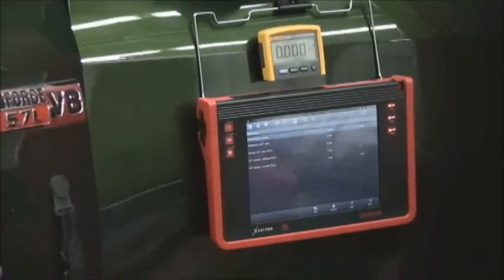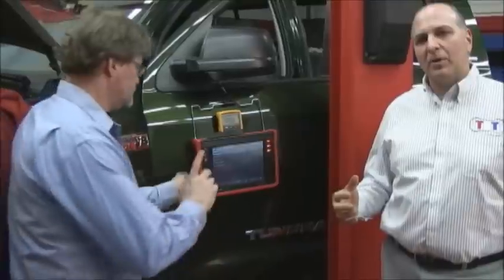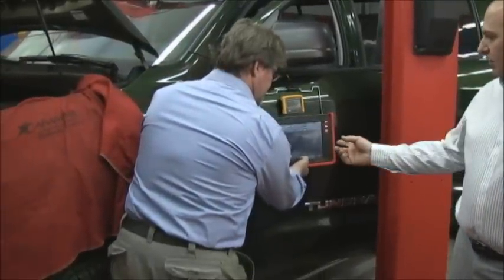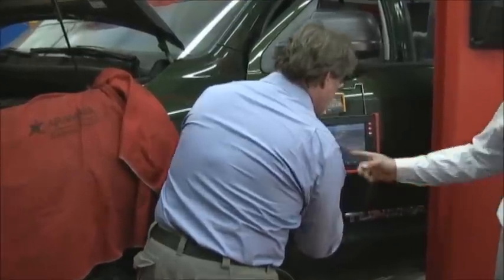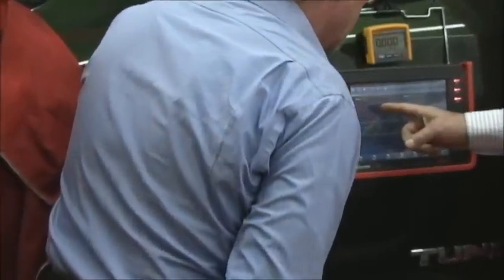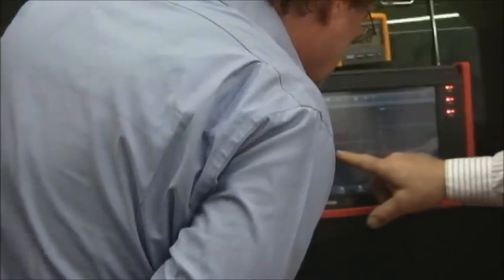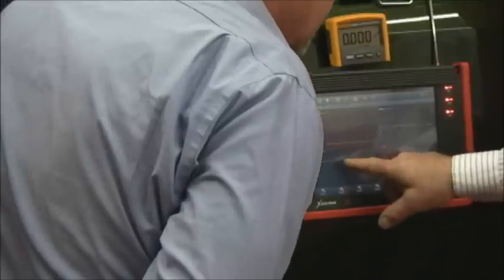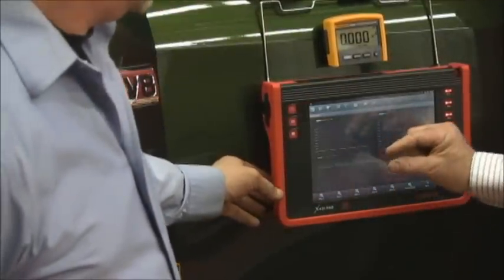This means we are in fuel control. Now this is going to be plotted. Yellow is going to be our air fuel ratio objective. Blue is the air fuel ratio bank one sensor one actual. The air fuel ratio voltage — there's the 3.3 with very little dithering. Remember, this is not like an oxygen sensor where it's going to go up and down a lot — that is very, very little movement.